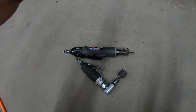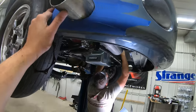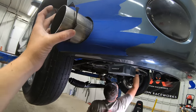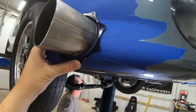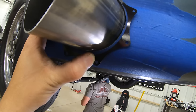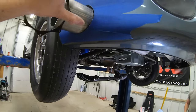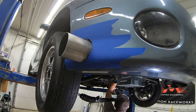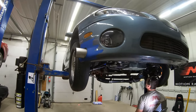I made the cut and used the barrel sander to work things out. It looks like I missed the hole a little bit on top, but this is exactly why I cut the hole small and work up on it — because I was cautious, I'll have plenty of room once I work the rest out. There's plenty of blue tape showing at the bottom and I'm right at the top, so I can use that top as my locating point, work out to the bottom, and keep the gap all the way around. Take your time — it's way easier to spend an extra 20-30 minutes than to try and repaint.